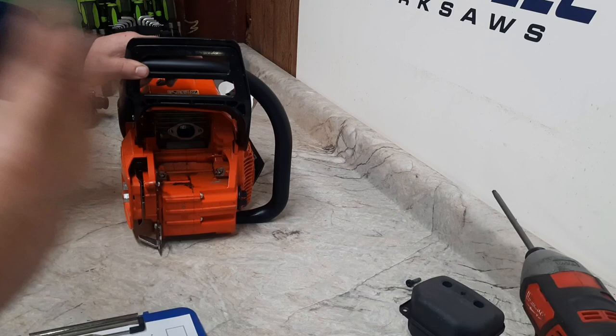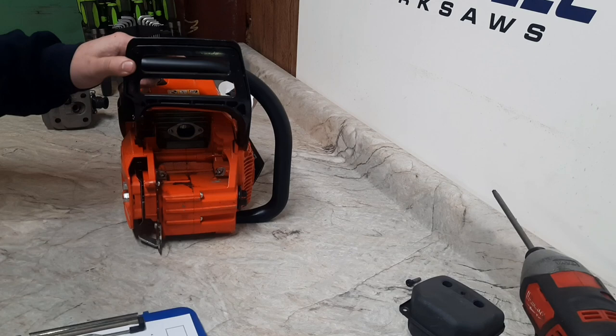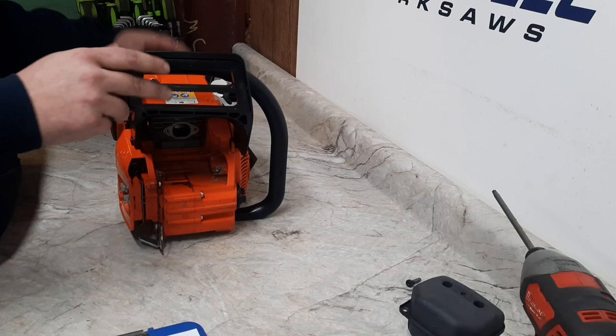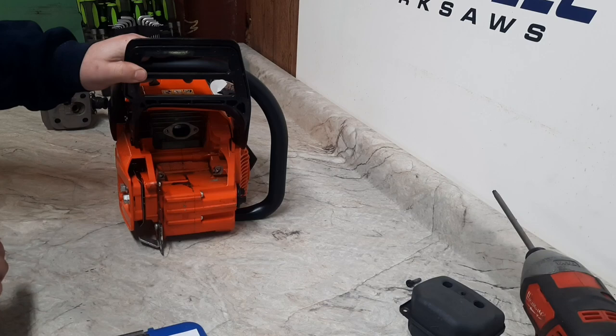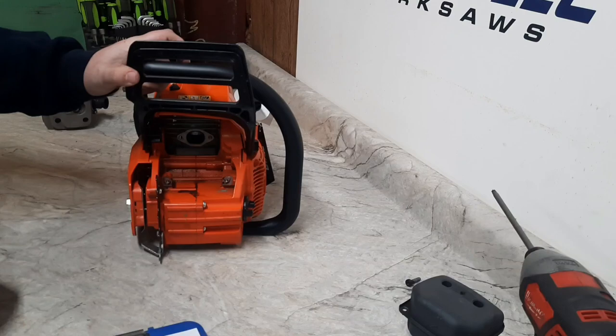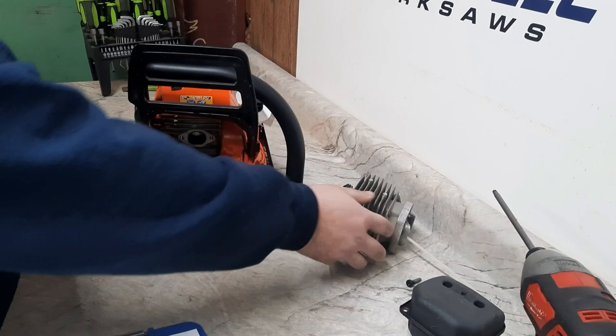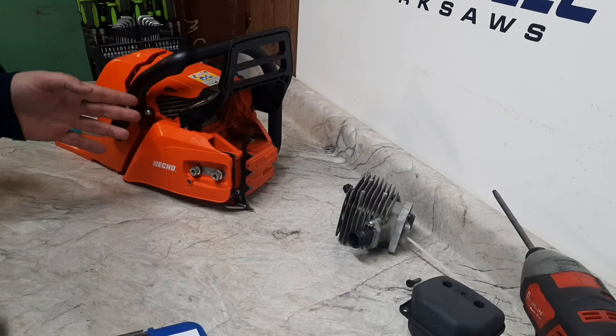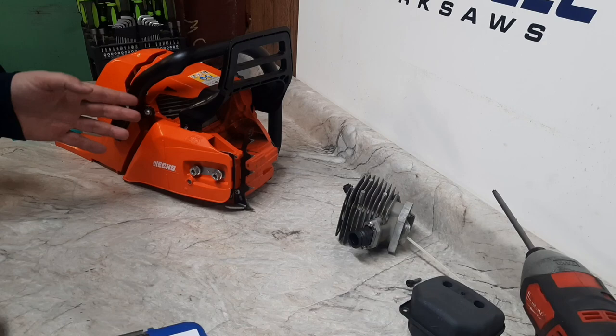This one came from a store return — probably a third or fourth party reseller. Whoever bought it from the store probably put their burned-up one in there, put all new pieces on it, and returned it to get a brand new engine. It showed up in a box with a bar and chain, everything just like it came off the shelf. If you just peek in the box, it looks new — but you really need to take your time with these super cheap ones. Pull the muffler off with a T27 — that would have saved this fella some money. I do have a used 620 cylinder we'll put on it, which will throw the numbers off a little, but that's what we have to work with.